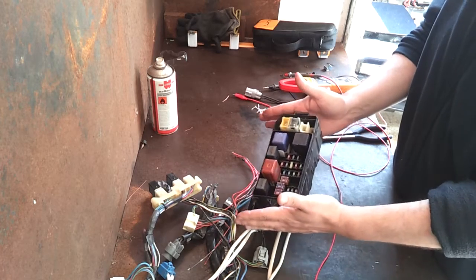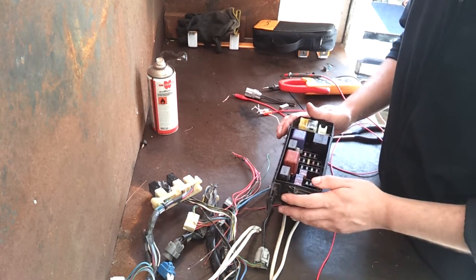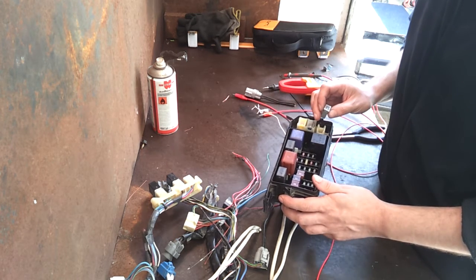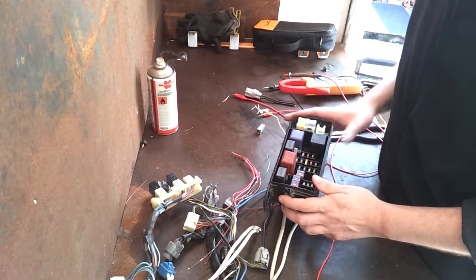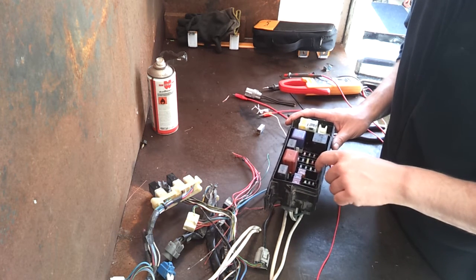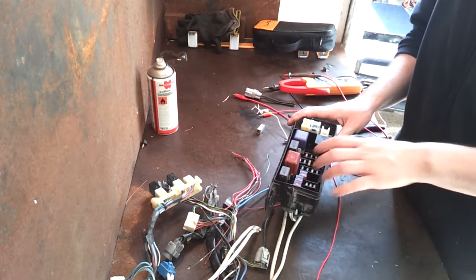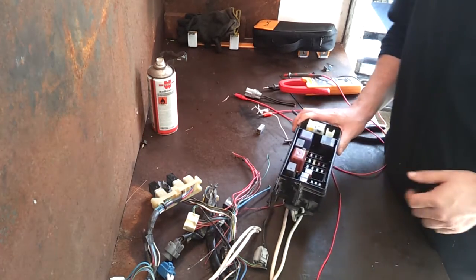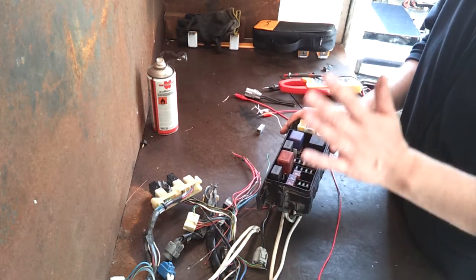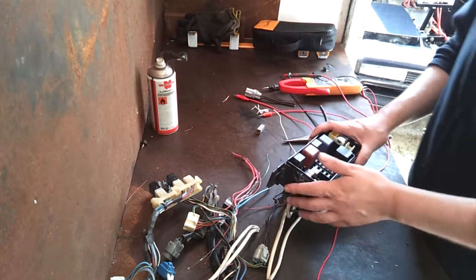What I've got now is a nice compact box. It's got five relays, three high-current fuses — 60-amp, 100-amp, and 40-amp — three medium-current fuses at 30, 40, and 50-amp, and seven standard blade-type low-current fuses: 5, 12, and 15-amp. This is probably way more than we actually need for the car, but in these cases it's no harm to have extras.